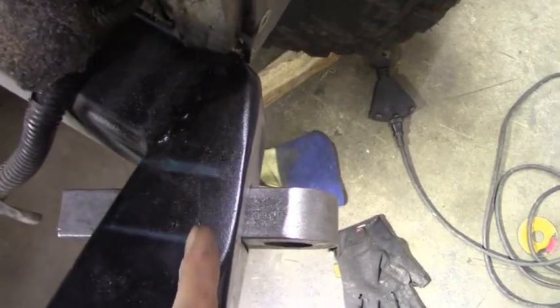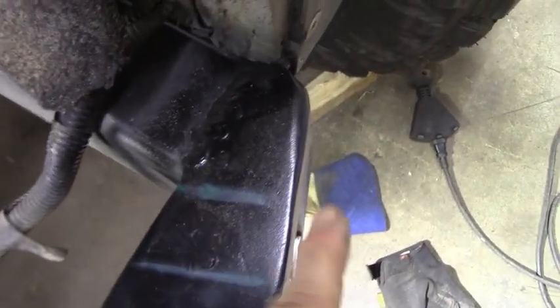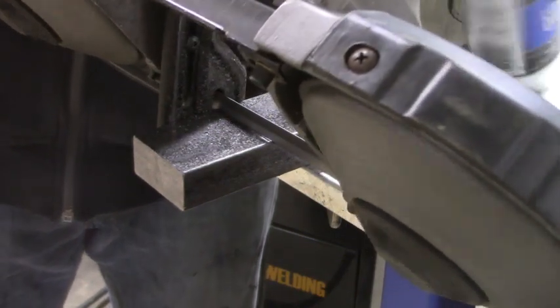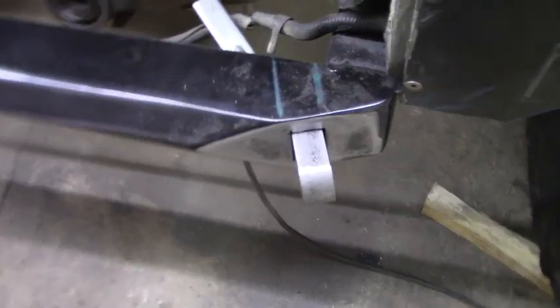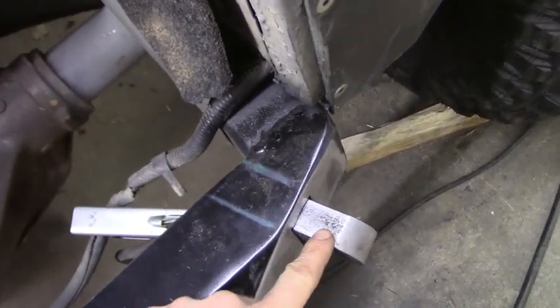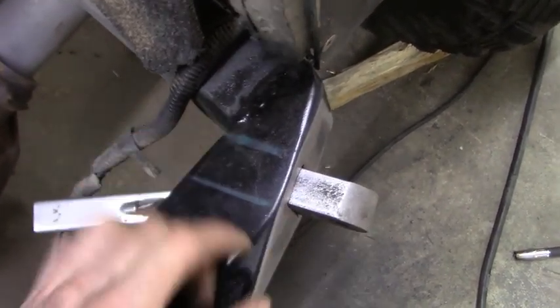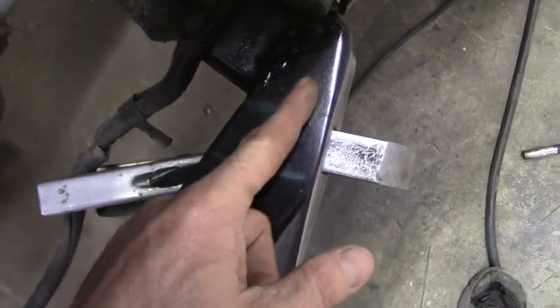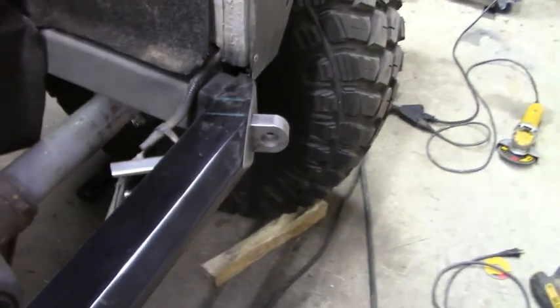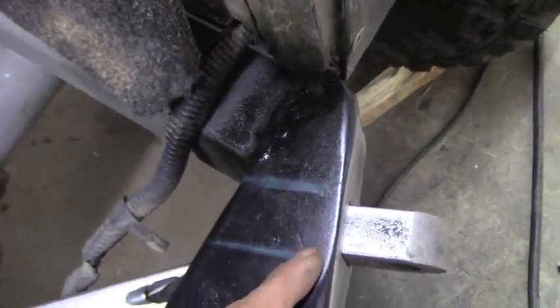Now I got the D-ring stuck through. As you can see, it's not at the angle I want, and the reason is because it's hitting the frame. So what I'm going to do is cut the D-ring shorter and then it'll actually run into the frame right there, so I can weld it to the frame and weld it on the inside and outside of the bumper. We got the D-ring tacked in. To figure out how long you need your D-ring, the best thing is to put the D-ring on the mount and put it in, making sure you have a little bit of a gap so it's not constantly rubbing your bumper. Once you figure that out, you figure the length and cut it. When you put it in, you also want to make sure it's straight with the bumper itself, both side to side and up and down. Now I'm going to go ahead and burn it in out here, then tie it into the frame, and also run a bead on the backside of the frame.